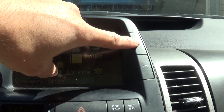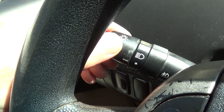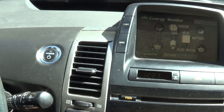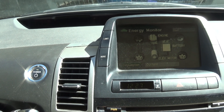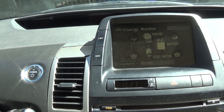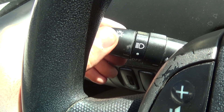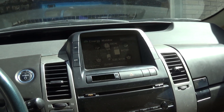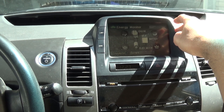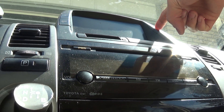What you're gonna do is hold the display button while flipping the headlight switch three or four times — from off to parking light. I've tried three and then had to do one more, and I've done four and it went on three, so just try three or four times. I'll put the camera down to do that now.